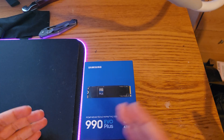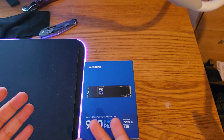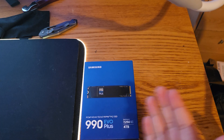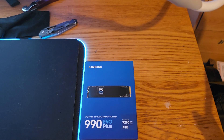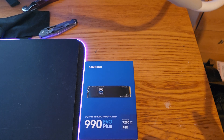When looking at performance, these are Gen 5 devices so speeds are above 5000 MB/s. When downloading a game, your first bottleneck is your internet speed, not your RAM or drive. Most people's highest connection is around 1 gigabit, so you aren't bottlenecking these drives. When you load a game it will start up quickly, so there's no noticeable impact. The main things to look for are power draw and thermals — I'd recommend the Evo Plus because its active power is quite low.